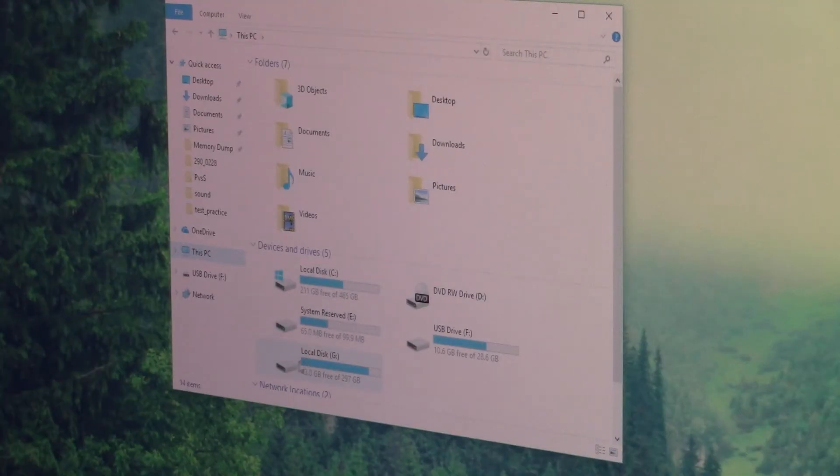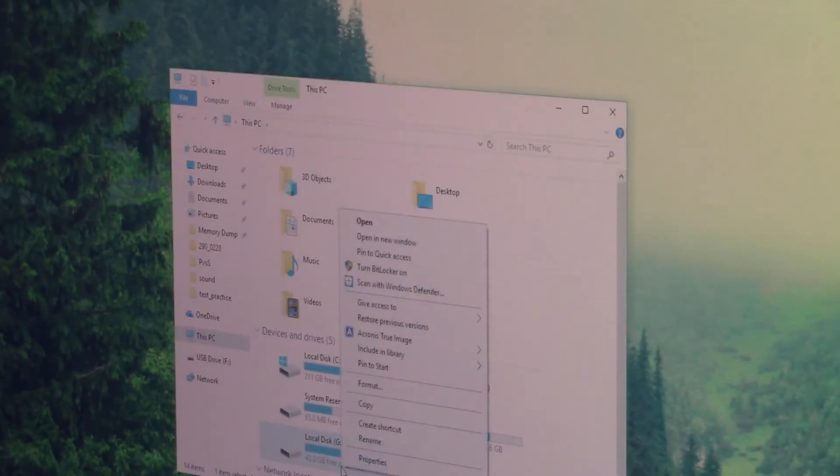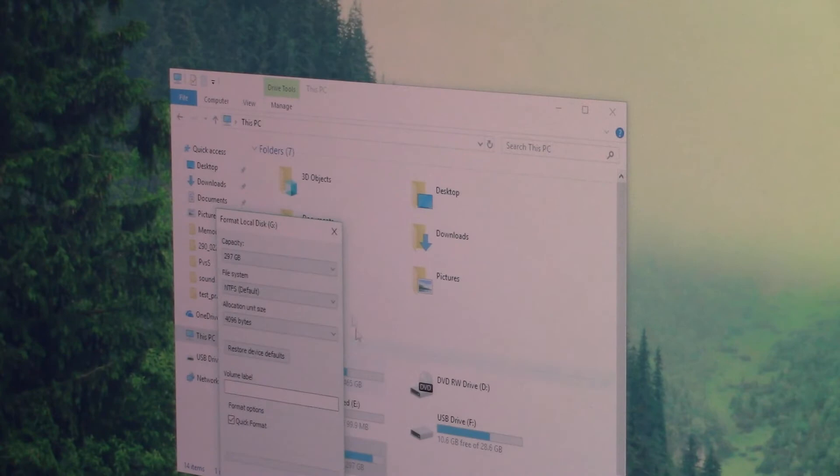And that will be noticeable — that will be fast. Now that you're in, you can go ahead and use a third stage, but that's quite straightforward. Just right-click on your old hard drive, which will still be detected, then click Format and follow the options you get, so that you can use it as extra storage. Do make sure that all your files have been moved over properly first — that's important.